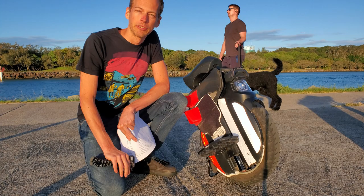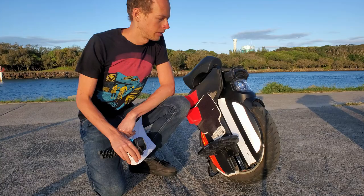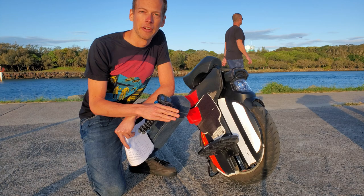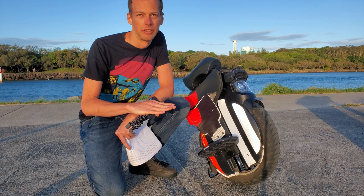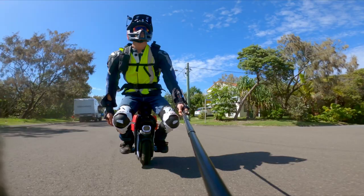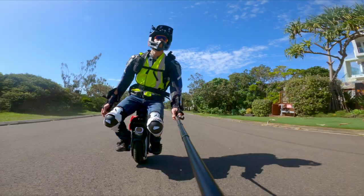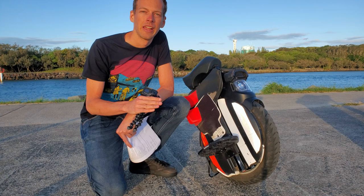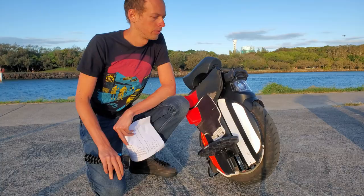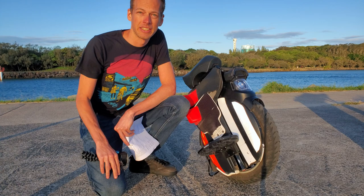All the reviews I've heard say the front light is one of the best. When riding, the wheel protects you with tilt-back — at 100% battery that's 50km/h, or in Fancier mode 55km/h. However, as the battery drops off, that tilt-back threshold lowers as well. The wheel will also beep at you, but when you're going really fast with wind noise and a full-face helmet on, you might not hear it — that's where EUC World paired with a Bluetooth speaker gets those alarms audible. When it comes to charging and battery safety, there's no smart BMS, so there are fewer checks and balances. InMotion did release a firmware update which helps check for dangerous conditions and alerts you via the app or wheel beeping.